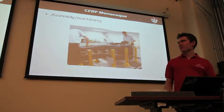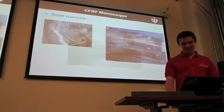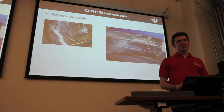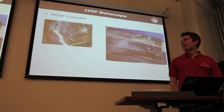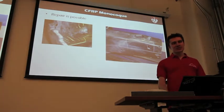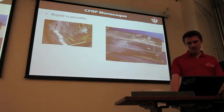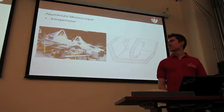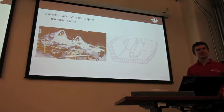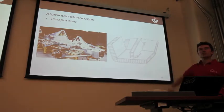You can't really make a monocoque in one piece usually, so people try to make it in at least two parts. I mentioned that repairability is important for FSAE — it's usually pretty difficult to repair things out of composite materials, but it is possible, so that is a bit of a drawback of choosing a monocoque. One other type of frame worth mentioning is the aluminum monocoque, which was popular in Formula 1 in the 70s, and that has aluminum face sheets with probably some kind of honeycomb core.